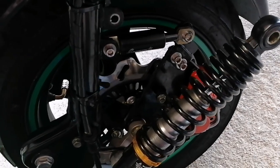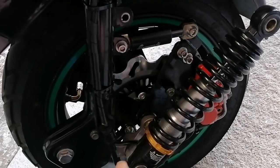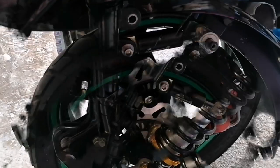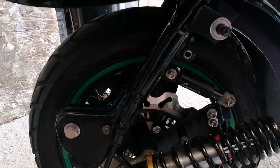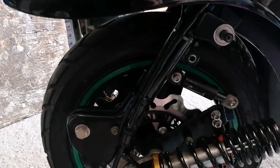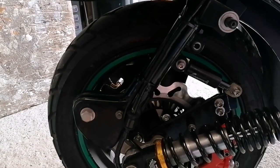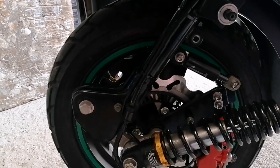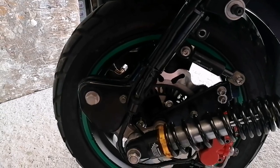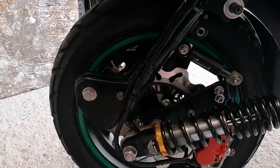When I say symmetrical, it's a square. You've got that nearly parallel to that one, where in the old place it was not. Steel Weasel gave me the inspiration for this. He moved one down on a Scomadi. And you could see just from the filming he did that it makes the front end much more responsive and not so stiff, because it's not working against itself.